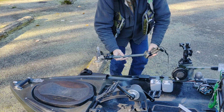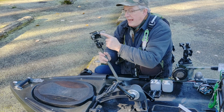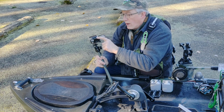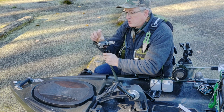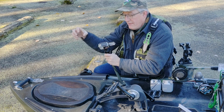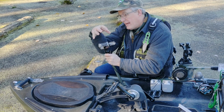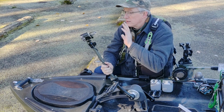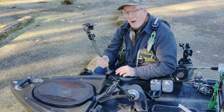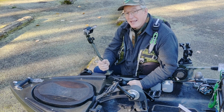And one of the nice things about this is that this is an add-on that I created. It's an acrylic tube that I glued to the side of the waterproof case, and that allows me to connect the USB cable to the camera while it's outside of the case. And then I can put it in the case while doubling the cable over inside that tube, and then I can latch it all up and it becomes completely sealed and waterproof. Now you won't find too many cases that you can remote power and be waterproof, but this one does it. I've fished it out of the lake and there's no water in it.